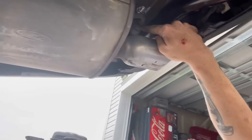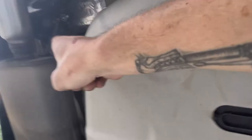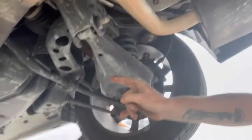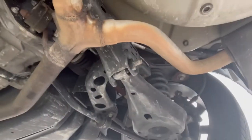To do this job, there's a hanger right here — you take it free from this piece. The actual muffler hanger, there's one over there too, and then there's one right there. Then you take a strap and go across from there to there, so when you drop the exhaust it lands on the strap. Pretty easy, right? That's what I thought too.